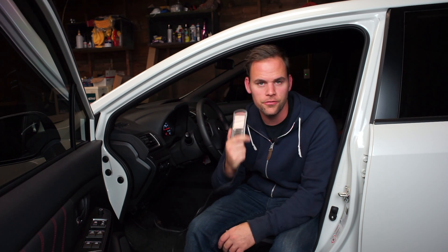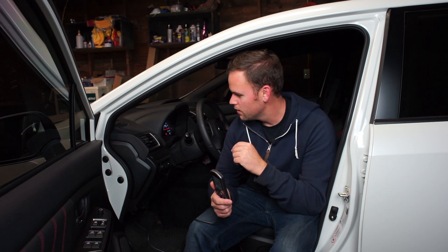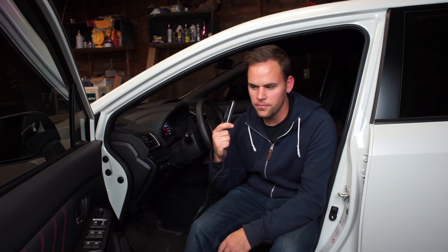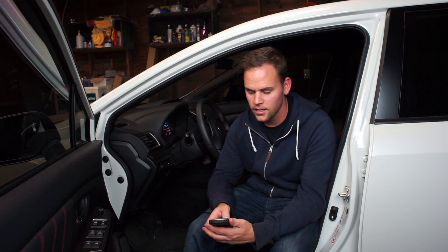I hope you found this video helpful. If you're new to Subarus, I hope this helps you understand what the Accessport does and the do's and don'ts. Just remember: you have to run a map for your specific mods — you can't throw on a Stage 2 map with TGV/EGR deletes and a bigger turbo without a proper tune. Once you start tuning, be tuned for the right parts. It's a really fun mod that makes the car a lot more fun to drive. Drop any questions below, subscribe, and we'll catch you next time.